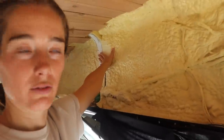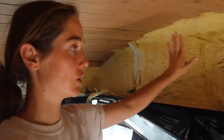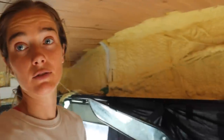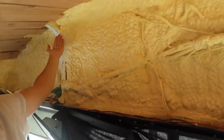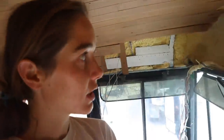So anyway, my plan is to have two sort of bracing pieces right here, boom and boom. I'll have to scrape that off. And then attached to those, just one large, pretty flimsy piece of plywood or something to cover the insulation. It's not gonna be any sort of structural thing, if that makes sense. My reasoning for bumping it out a little bit is because so much of this insulation comes out further than those beams, so that I won't have to try to scrape that all flat, but also so that hopefully I can avoid dealing with this curve as much as possible. If I move this forward, I think maybe it'll come up where that curve's not gonna get in my way, because I'm just so over these freaking school bus curves.